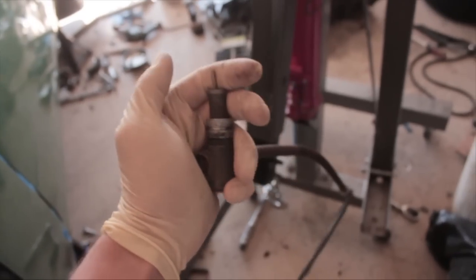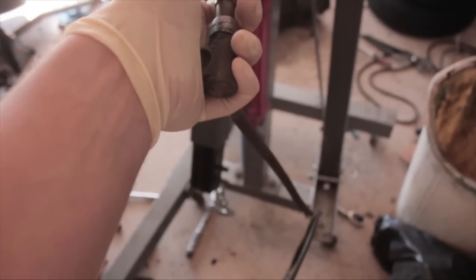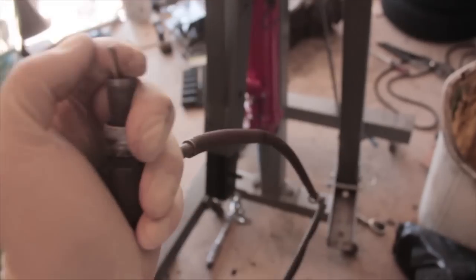Today we're going to install the speedometer cable. There's the little pin in there — you don't want to lose that, it's a pretty pricey penny. A lot of people use either a lithium grease, like the old Model T guys, or a graphite grease — basically a non-migrating grease to lubricate your cable. This cable is pretty resistance-free so I'm not going to lubricate it today. Besides, I don't have either of those things. I am going to lubricate the ends of it so it doesn't give me a problem with my speedometer or the 90-degree angle fitting. I've got about two hours of work — hopefully we can get that in, install the oil seals, and get it connected to the speedometer cluster.